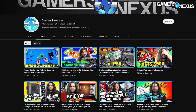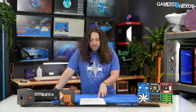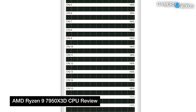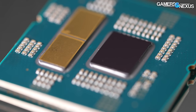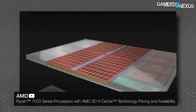Here's the quick overview. The 7950X3D and 7900X3D have already launched and we reviewed both separately, explaining the CCD issue and core parking issue in detail. The 7000X3D CPUs stack V-cache on only one CCD. AMD's Ryzen 7000 composition is a maximum of three chiplets: one IO die, one primary CCD, and one secondary CCD. The primary CCD gets the V-cache. On previous X3D CPUs, you'd have to park half the cores during gaming, because otherwise crossing the infinity fabric to the secondary CCD for V-cache hits added latency that hurt performance more than just restraining gaming traffic to a single CCD.